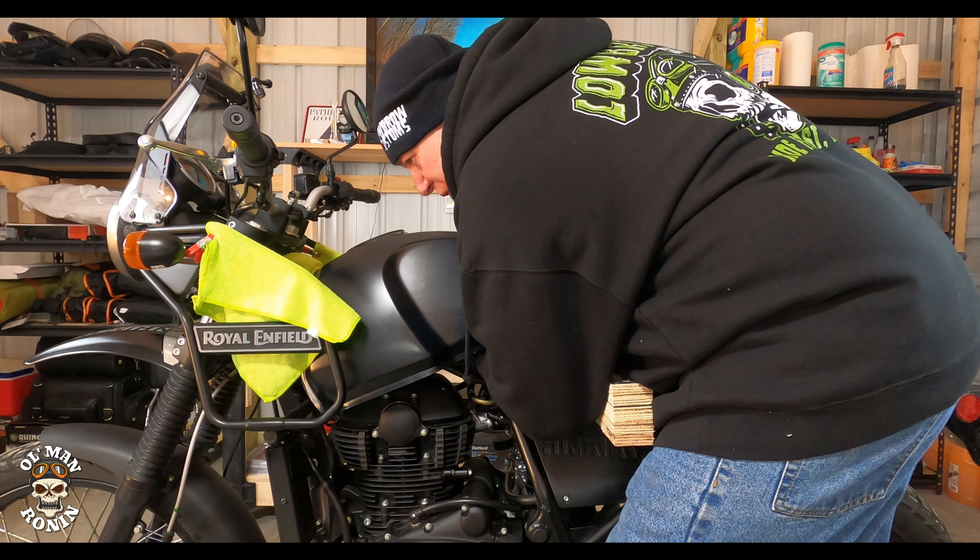Also look underneath and make sure there are no wires pinched. Now we're going to start it up and make sure she'll run. Turn it on and listen for the fuel pump — fuel pump seems to be working good. Engage the cold start and let it run a little bit. I want to make sure the fuel gauge is working, no strange warning lights, and that I've got good fuel going into the fuel injection system. Wait a few seconds, and then we'll put the seat on.